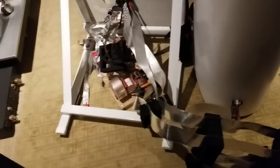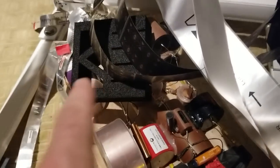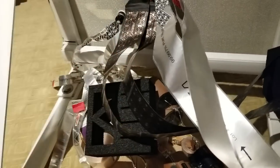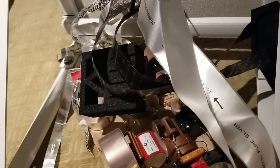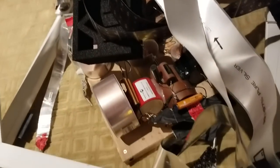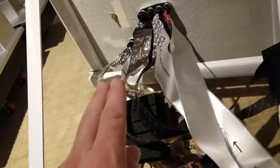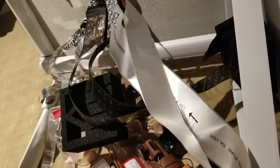Here is how the cables are coming into the speaker. Down here I have a crossover that I've made — a passive crossover. This is the thing you kind of want to eliminate. But I left it here because I'm going to run the tweeter through here. The tweeter is just going to go through the tweeter part, pop out the other end, and go to the tweeter in the panel. The reason I do that is because this will protect my tweeter. If any wackadoo stuff comes from upstream, it's going to protect it — give it protection against snappage. This is a ribbon tweeter, and it's super delicate and super easy to snap. You're hooking the amplifier directly to the ribbon tweeter with nothing in between — any little pop when you turn the thing on, if it doesn't have a mute circuit and just goes pop, it'll break your tweeter.